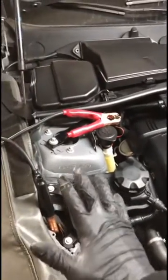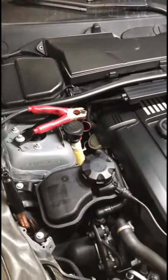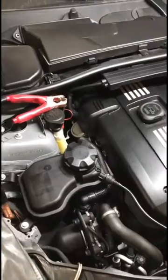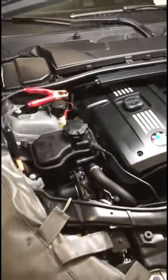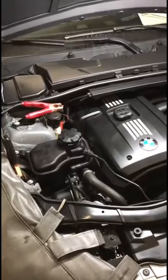Make sure you have a good battery source. If you're in a bind and on the side of the road doing a repair, as long as your battery is okay, you can get away with bleeding it without an external power source. Also, in between bleeding cycles you're going to want to cycle the key — especially before you start it. Shut the key off after it's done bleeding, then turn it back on and you can start it. That helps reset the pump so it's not in bleeding mode anymore.